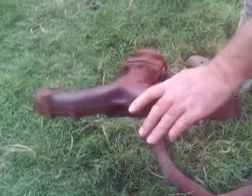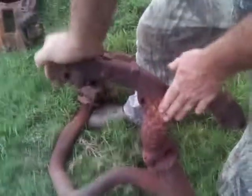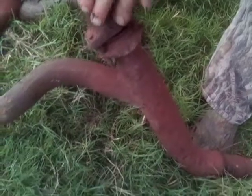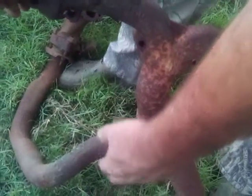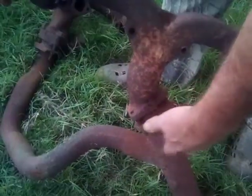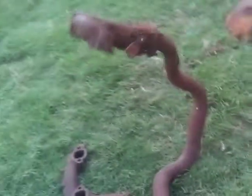See that right there on the passenger side? It goes straight down. This is off of a '65 Chevrolet car. But this one on the driver's side swoops back. It's off a '65 Chevrolet car. That's fine and dandy if you're using an automatic. But if you've got a stick, you have to have one that goes straight down on the driver's side, because this one comes back and gets into your clutch linkage. I just didn't happen to have one.